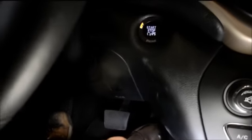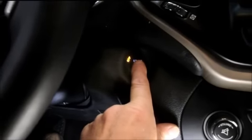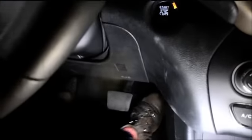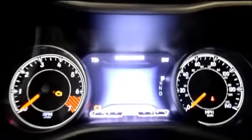So let's give it a try. No foot on the brake pedal, turn the ignition on, step three times within five seconds to the floor. And it should reset the maintenance reminder light.